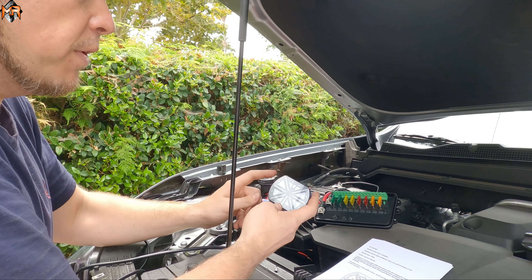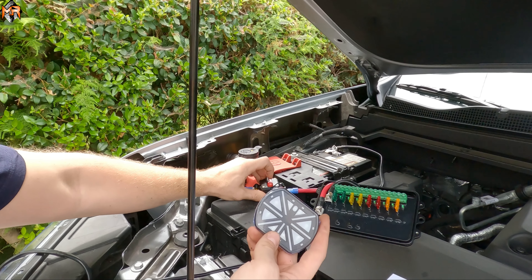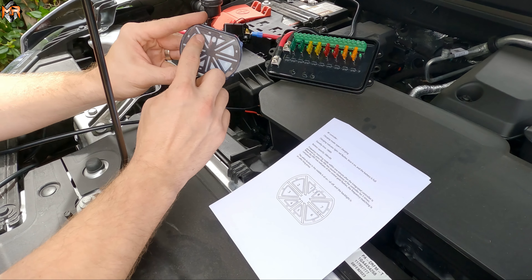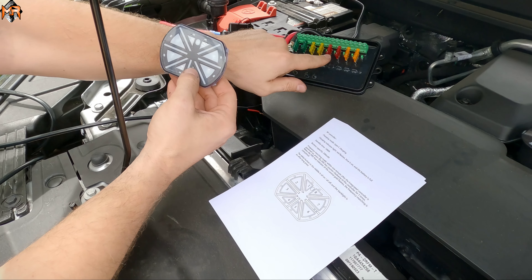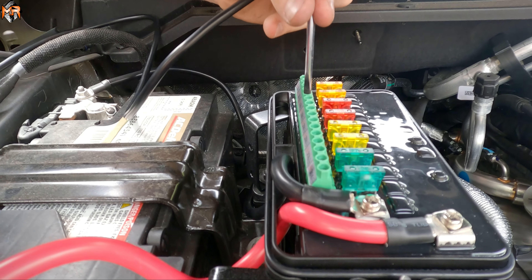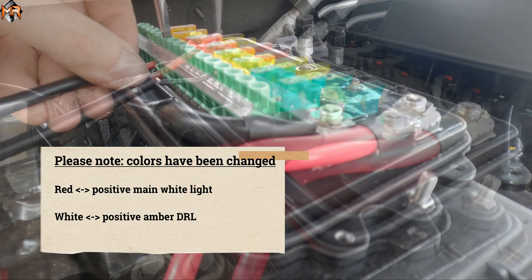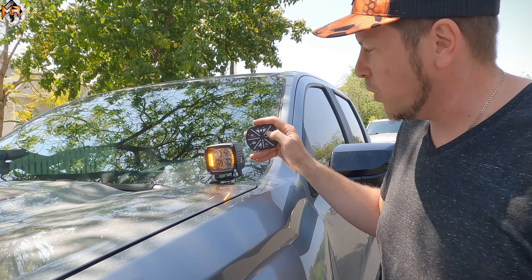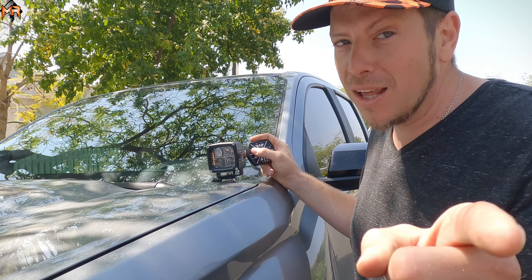Let's go ahead and pair the remote to the frequency and circuits so I can start utilizing the module. I'm going to put power into the control module — based on the instructions, press the fifth key counterclockwise five times. Notice this light is blinking, which means it's paired. We're going to use a 10-amp circuit and tighten it down — the red one is the positive. Now that all the wiring is done, let's test the lights. This button controls the amber DRL, and this button controls the powerful white light. Thank you guys for watching — you're going to love the product.